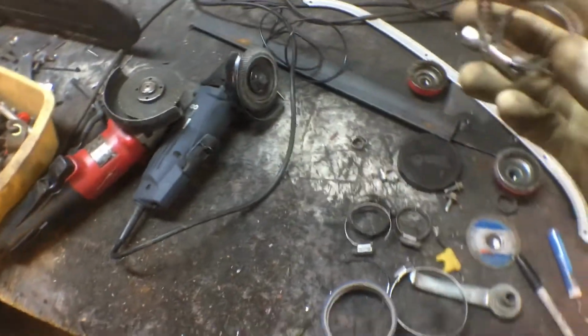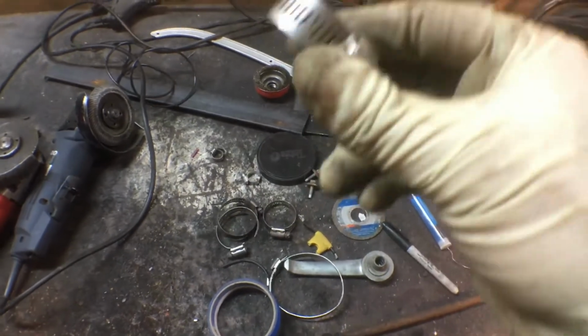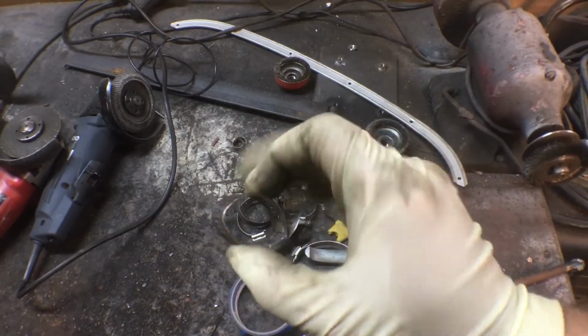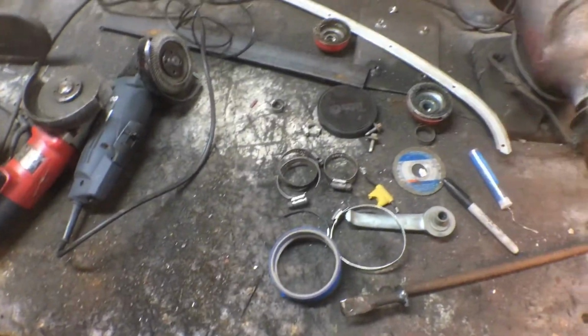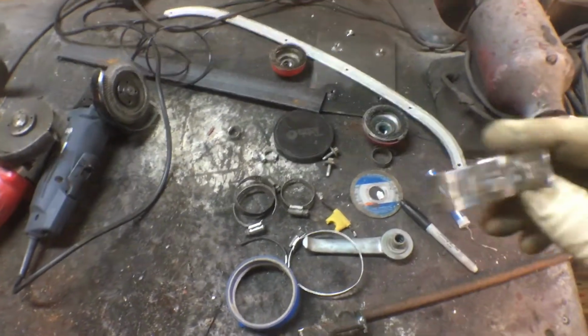this invention, and drilled a little hole in this hose clamp, and I just squeezed this over the shift linkage and the rod on the transmission. This ball sat in there, and it kind of didn't move until it popped off. I don't know if it got loose or it stretched, or that hole just got bigger, but I knew it was going to be temporary, so I ran the shift linkage.